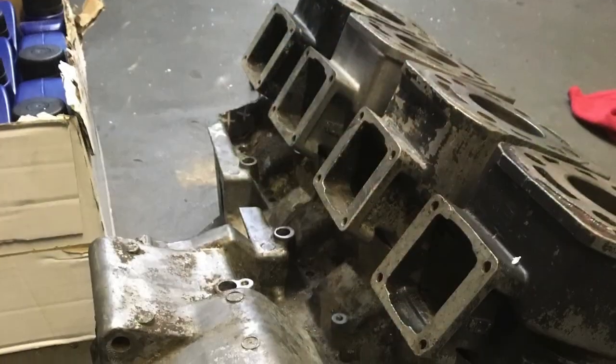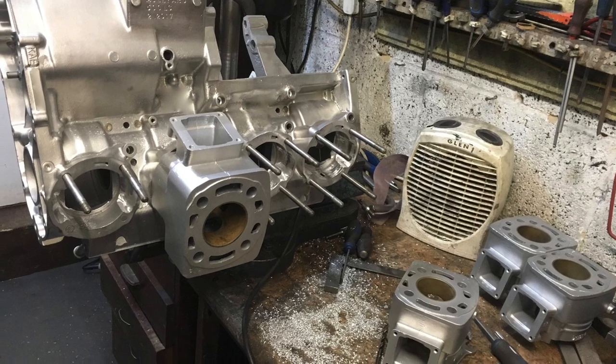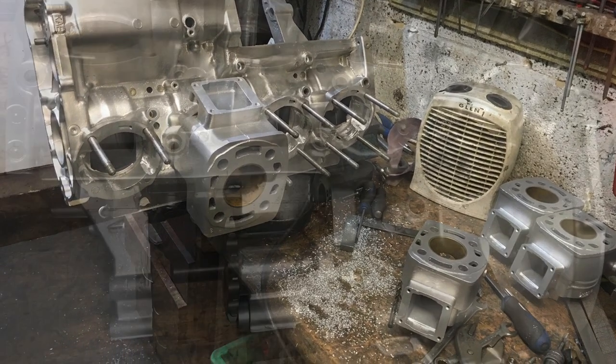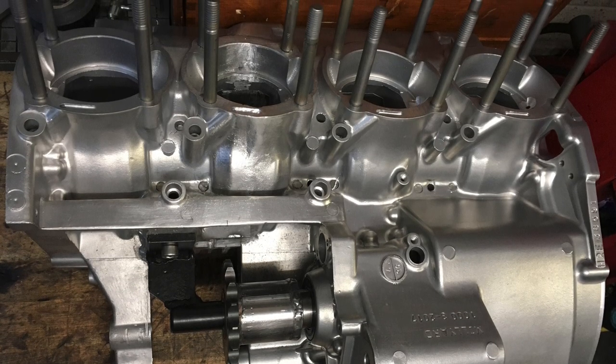The first thing I had to do was to convert some Kawasaki KH500 crankcases into four cylinder, like I do with my air cooled versions. Then I tried to fit some Yamaha RD250 LC barrels. The problem was they didn't fit — the crankcase mouths were too small, the studs were in the wrong place, the deck heights were wrong, and the pistons would come straight out the top of the cylinders.